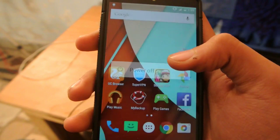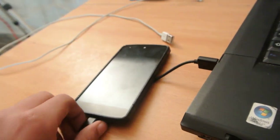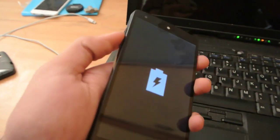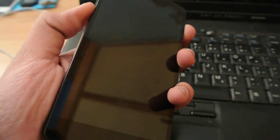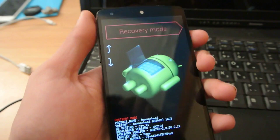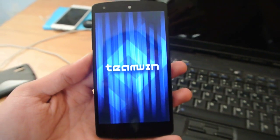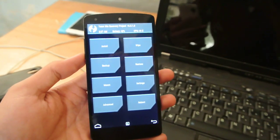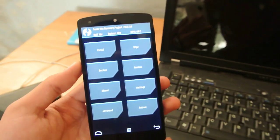Let's try to power off and then boot up into recovery mode. Disconnect the laptop — as you can see my laptop is now off, so that was close. Boot into the bootloader menu by holding the power and volume down button at the same time, then go into recovery mode. Let's see if TWRP recovery is installed — yes! This is the recovery, version 2.8.1.0.